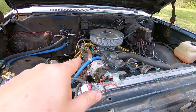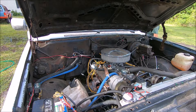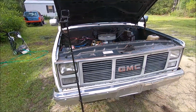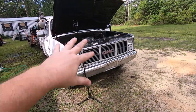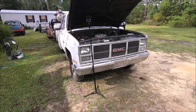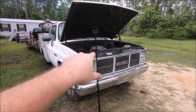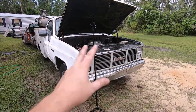You can see we're running at about 3 PSI. That's a little low for spec — you should be running about 6 PSI for a standard mechanical fuel pump, roughly 6 PSI plus or minus. So we know either the fuel pump is bad or the bypass is bad. The fuel pump is still putting out some pressure, but how do we know if the pump side is good and the bypass is bad?